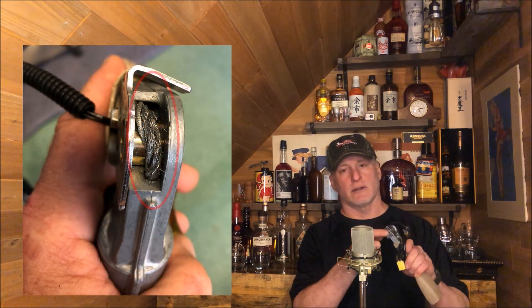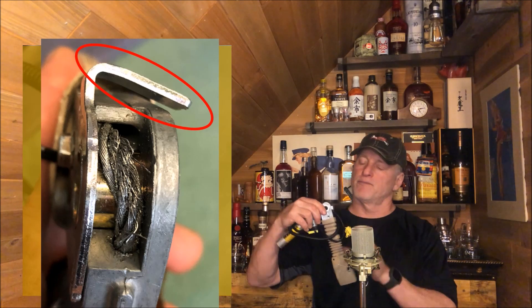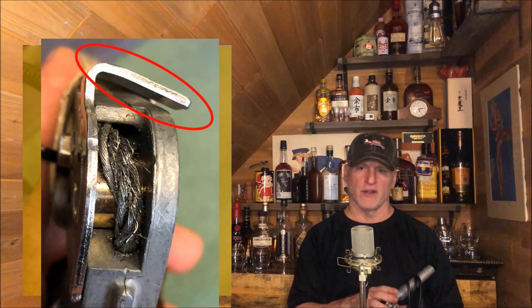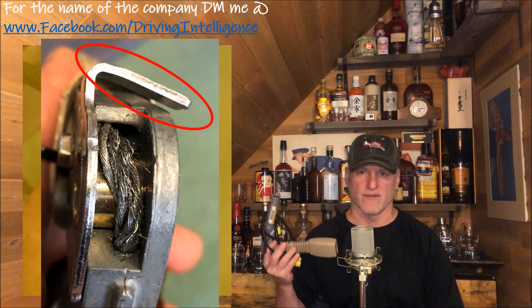But when they did the replacement, they actually damaged the unit. There's a cable that goes around here, as I've already mentioned — it's all frayed and damaged. And there's a locating clip here that was pushed in. So I had problems installing it, and I was absolutely not going to install something with a damaged safety cable that's attached to the buckle and supposed to save your life in an accident.